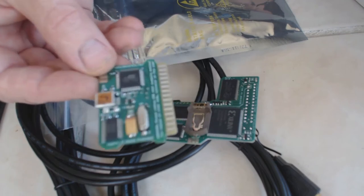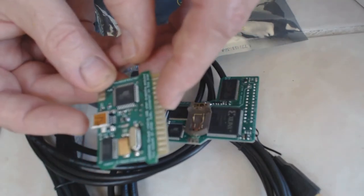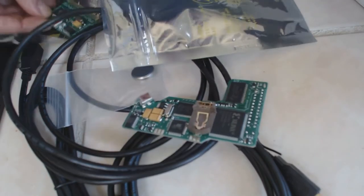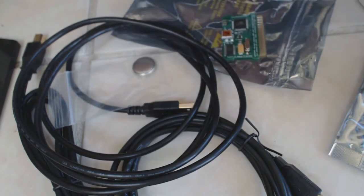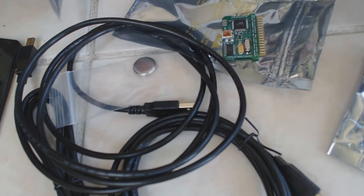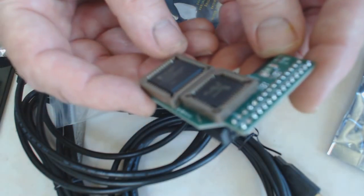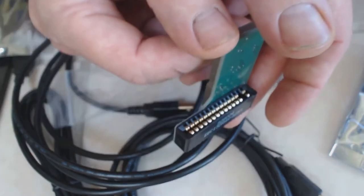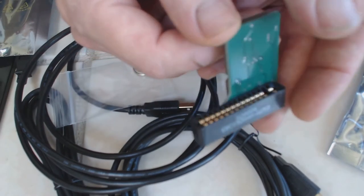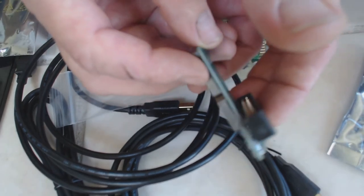This is their Jaybird burner, obviously with that same micro USB interface. And here is the Moates chip, which would actually hold the program when it is burned permanently, and take the place of the Quarter Horse inside the unit to actually run the vehicle.